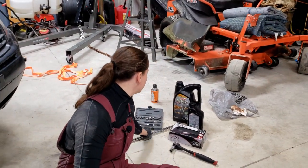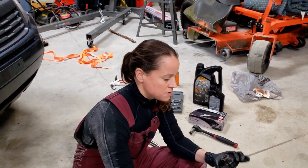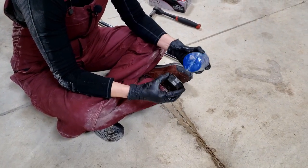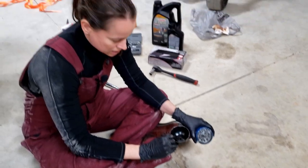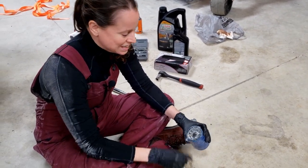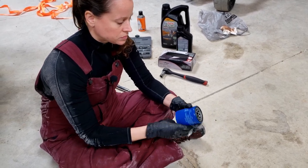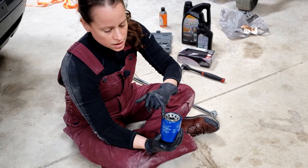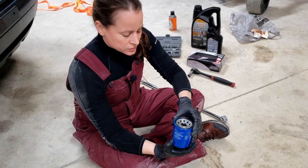Now we're moving on to that oil filter. The oil filter on this engine notoriously gives me trouble, so what I have here is a socket style oil filter wrench — it just fits right onto the bottom of the oil filter. The issue with this particular one is that it's not the right one, so I always have to pad it to make sure it's gripping correctly. In the Subaru, I always use Subaru branded oil filters because the gasket around this oil filter is rounded — any other one from the auto parts store is going to be flat and cause leaks.